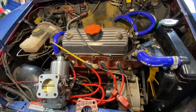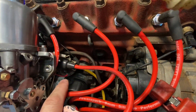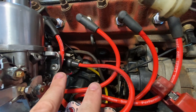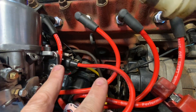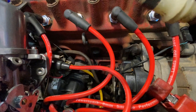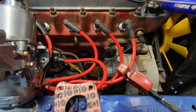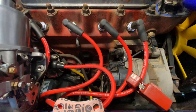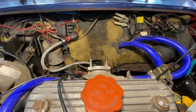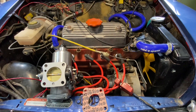So what we've now done is we've got into this tune: replaced the HT leads, spark plugs, and I also had to move the distributor drive around because the distributor would hit the starter motor due to all the mismatched parts that have been fitted. This distributor was never fitted with an inertia starter motor, so the module hit the side of the starter motor. I had to take it out, remove the drive shaft, move it around once. Because it had the wrong clamp and wrong alternator, I had to take the alternator off as well to get the spanners in. This one took a lot longer than one would normally imagine. Unfortunately the carburetor on it - no matter what I did - I couldn't lean it out at 2,000 revs; it was in the low 0.8s on fuelling. So unfortunately we've got to have a new carb.